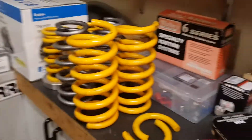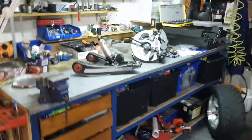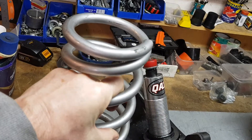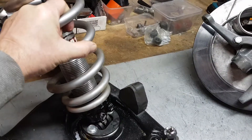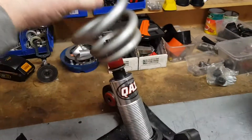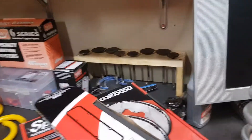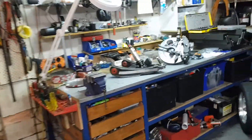Along with this we've got a lot of springs here. These are the standard ones — I'll show you how that works. They fit on the QA1 and come with the QA1 setup. This is the standard sleeve: three and a half inch internal diameter, fits up into your spring pocket and sits nicely on there, giving you that adjustability. It's a great setup — I think if I had a street car that'd be fantastic. This is the heaviest one I can get my hands on at the moment: 550 pounds, nowhere near enough.